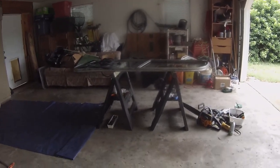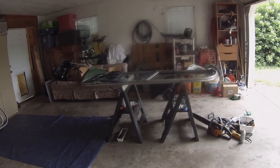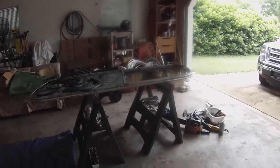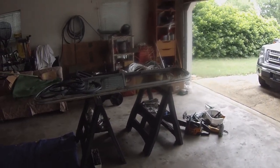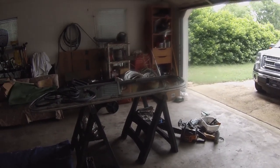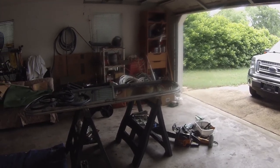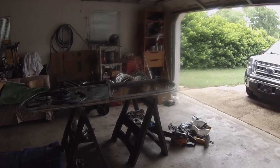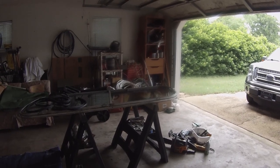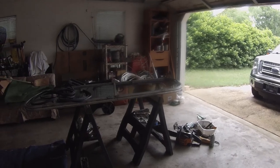Okay, so I'm back with the windows here next day, and it's come along. I went ahead and put the two panels in. I actually forgot to video that, but it's real simple. It's just like I had said earlier with the panels. You just put the felt runner or slider in and start at the crown of the bend and just tap it in with something light. You can do it with your hand, but it seems to snap it in place better with something light like the handle of that wire brush that I was using.